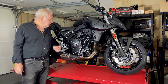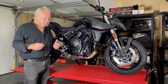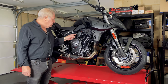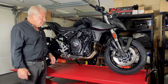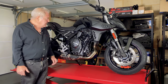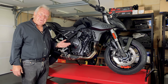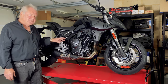You might wonder why they didn't just put a bigger V-twin in — the V-Strom 650 was a perfectly good engine. The reason is it was hard to get much more power out of that unit, so they had to start again with this parallel twin. V-twins have an inherent challenge: the rear cylinder runs at a different temperature to the front, and balancing those temperatures through various cooling methods is quite technical, as any Ducati race team will tell you. Heat is the enemy of power. If you've ridden a twin and didn't like it, you should definitely try one of these new-format engines.